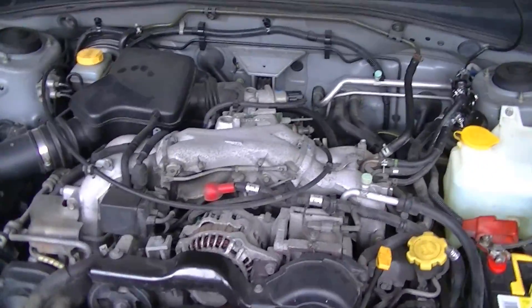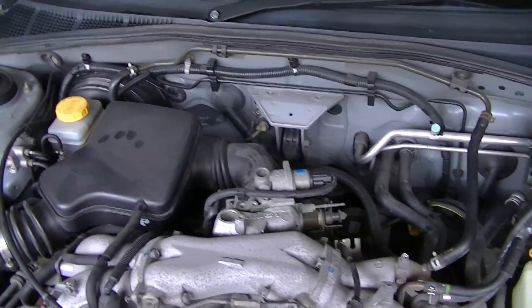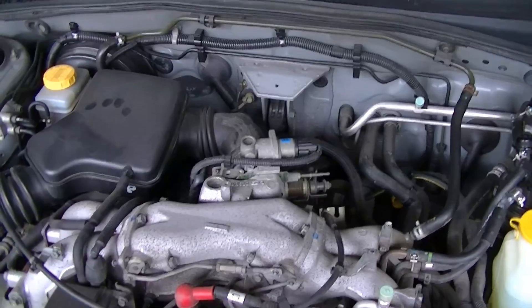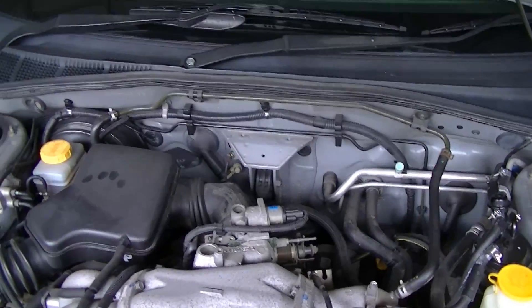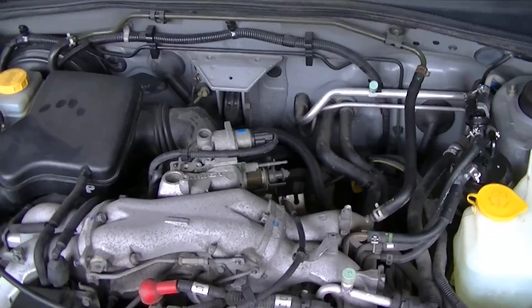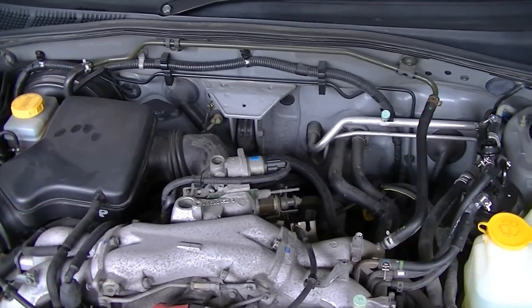Came down to try and help him swap it out today. I got him to crank it and the alternator pulley turned, so clearly it wasn't the starter motor, but it still wasn't starting. We pulled the codes — no codes. Looking at the dash, we didn't get anything on the tachometer when cranking the engine, and OBD2 data showed no tach signal.